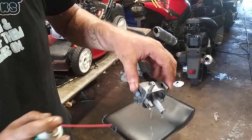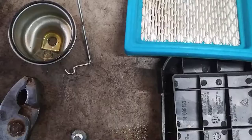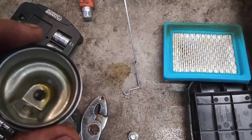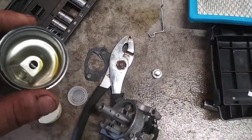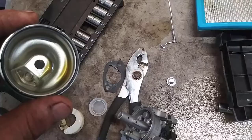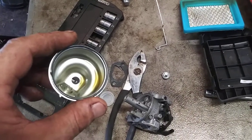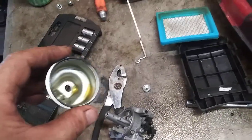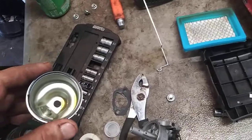A nice solid stream — and that's how you clean the carburetor out. Now we're going to clean the bowl out. See how the bowl gasket is stuck on there? I'm going to leave the gasket on there and just gently make sure I get it back in place. I'll give it a slight rinse — not too much because it's not too dirty. Anything you need like gaskets I'll put a link in the description so you can get a new carburetor or carburetor kit.